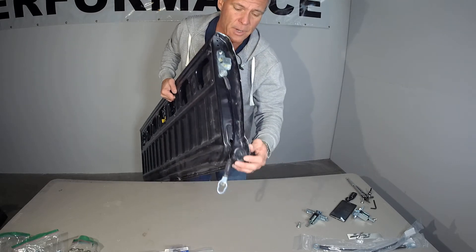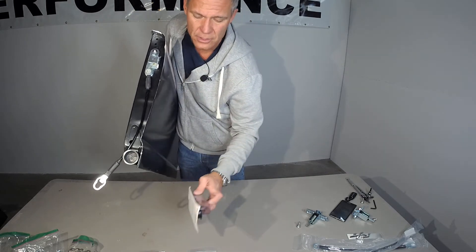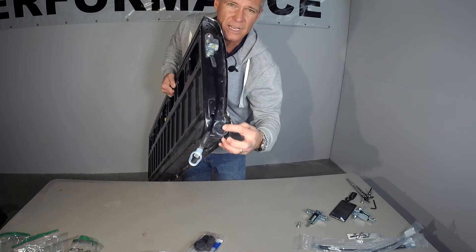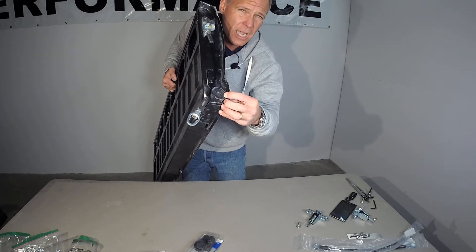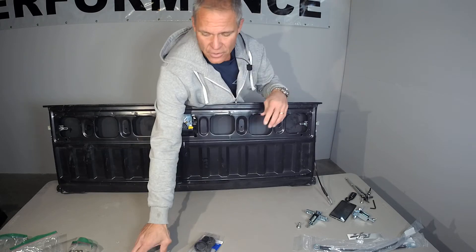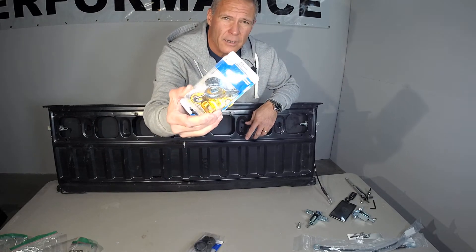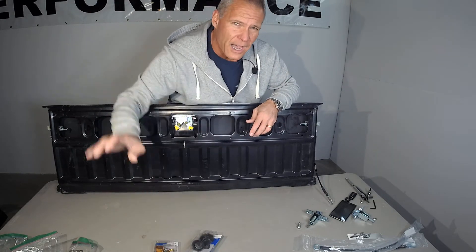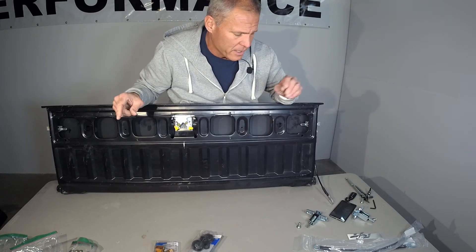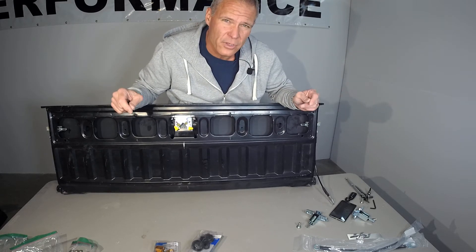On the bottom, there are plastic hinges — hinge liners. These are little plastic bearings that press inside the cups on the bottom. These are the steel hinges that mount on the car itself. The slotted one is on the right or passenger side; the round one is on the left or driver's side.